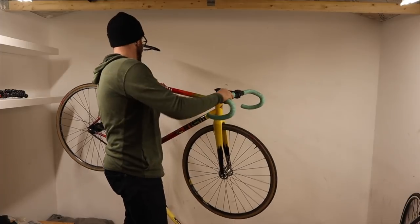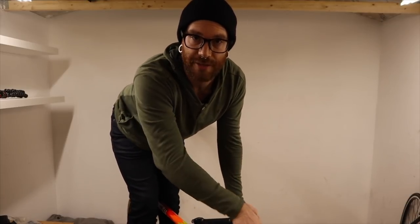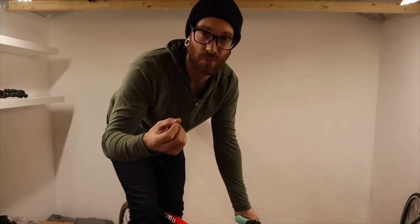First one to comment which bike this handlebar tape came off of gets a high five in person. One thing you do need to take into consideration if you're going to reuse bar tape is just knowing that it is going to come out thinner on the second, third, and fourth time than it ever did on the first. After the first installation you've really pulled it to where it's supposed to be, and it doesn't have a memory to go back to the thickness it was when originally in the packaging. So if you've got hands that go numb or you've purposely bought thicker bar tape because you like that feeling, maybe reusing bar tape's not for you — or you can try not to pull too much tension on it, though that introduces its own problems because if you don't pull hard enough it tends to come unraveled as you ride.